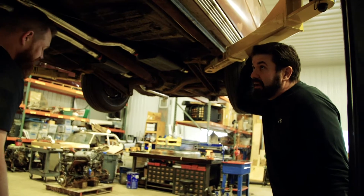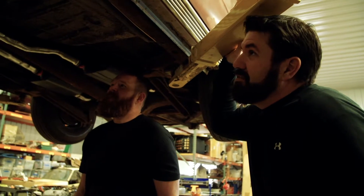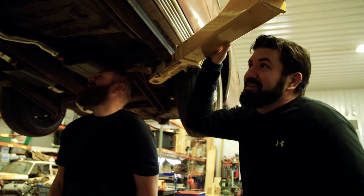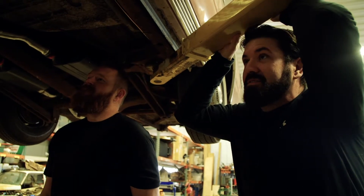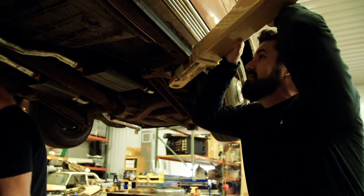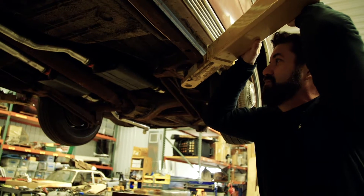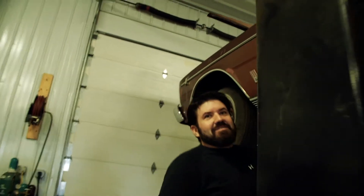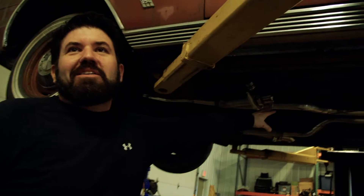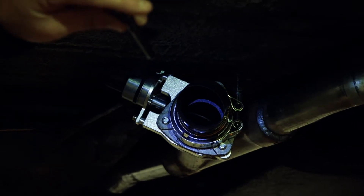As a country sedan, this car came with a single outlet exhaust system and we decided it needed to be just a little rowdier than that. So we went down to Red's muffler shop and ordered up some electric cutouts for it, put some 40 series Flowmasters on it and two-inch true duals. The reason why it's so loud right now — we put these on here just for when you want to be really obnoxious. If you open these up, it's like running no mufflers at the flick of a switch under the dashboard. It's time to party.